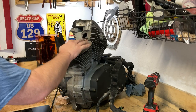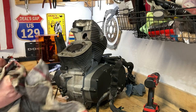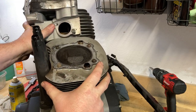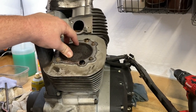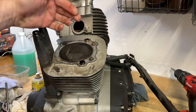Let me show you something else you can do. You can do a garage shade-tree mechanic style check for piston-to-cylinder wall clearance. You can take the piston — don't wiggle the entire block, wiggle just the piston if it will. You can attempt to wiggle the piston and there's hardly any movement in that. Man, that's a lot of carbon.